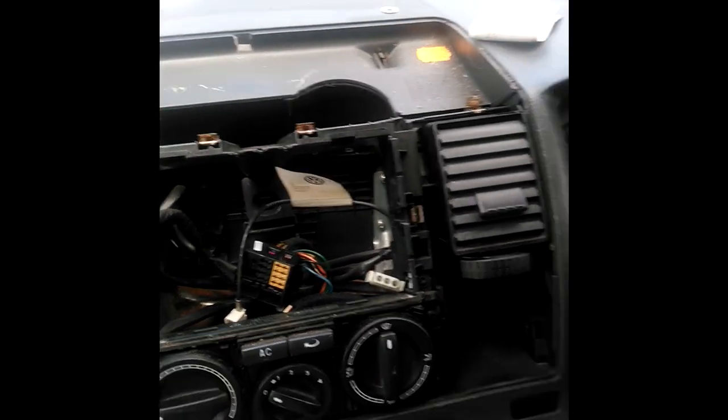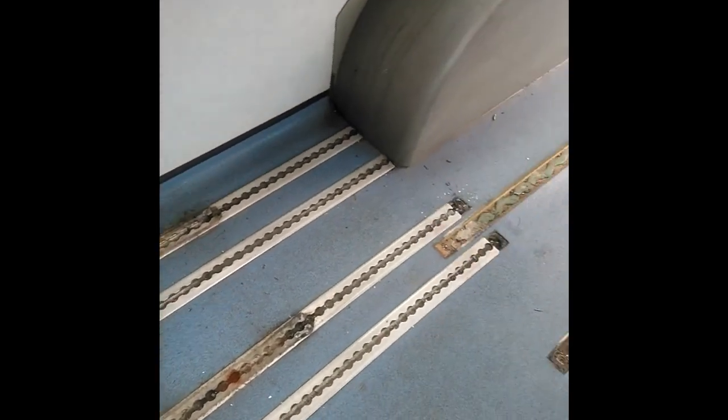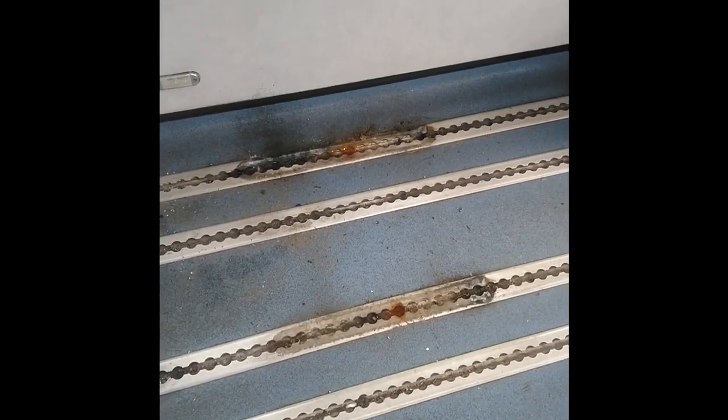That's all for the moment guys. Next job will be I'm going to have another go at these rails. I was using a metal drill bit, but I think the drill head was too big, so I'm going to use one of those little step drill bits so I can start off drilling the hole small and then make it big enough to take out the bolt heads that are holding these in. So that's the plan for today — I will see you later, bye now.